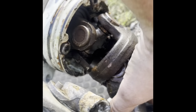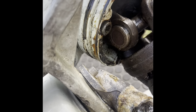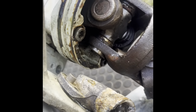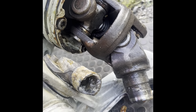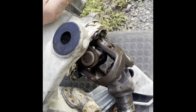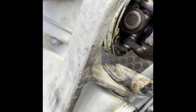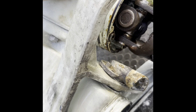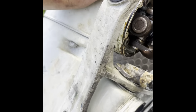And look at these U-joints. Oh, that's awesome. There's no slop in them. They got grease fittings like this. This is like unheard of. Every person I've seen take these things apart, they were just destroyed. You could buy that whole assembly, but it ain't cheap, or you can redo the U-joints yourself. But I'm not gonna, I'm just gonna grease them up and roll with it.